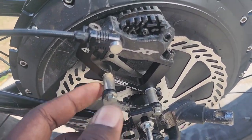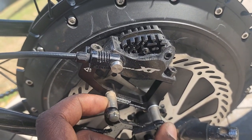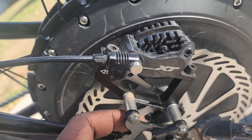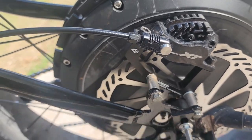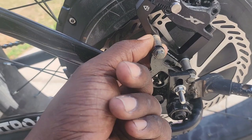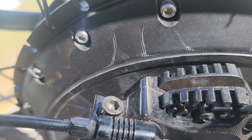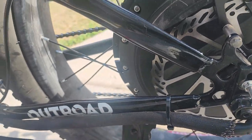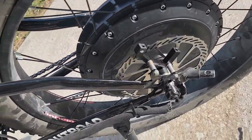We're having issues with the rear brake caliper — it's creating so much stopping force that it's actually moving the spacers; they're not strong enough to hold the bracket in place. The caliper is actually flexing right here and bending the bolts, and it's actually rubbing on the motor. I've got to figure out how to stop that from happening because the brakes themselves are working fine and locking up — it's just the flex causing the problem.